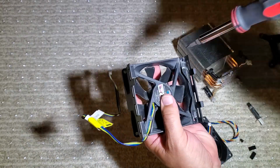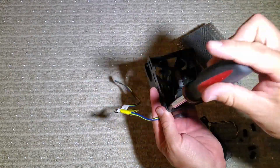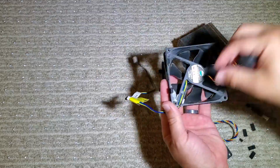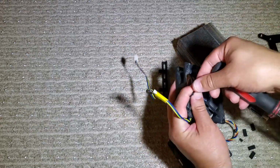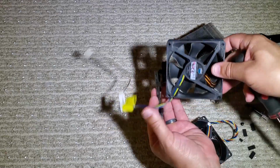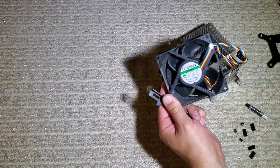One other note on the fan, I realized that this Dell fan, the 92mm one that I sourced, is a case fan, so it probably doesn't have the best static pressure, but we're going to have another fan pretty close for exhaust behind the cooler, so I think we'll get a little bit of a push-pull effect from both of them that'll help get some air through the cooler.